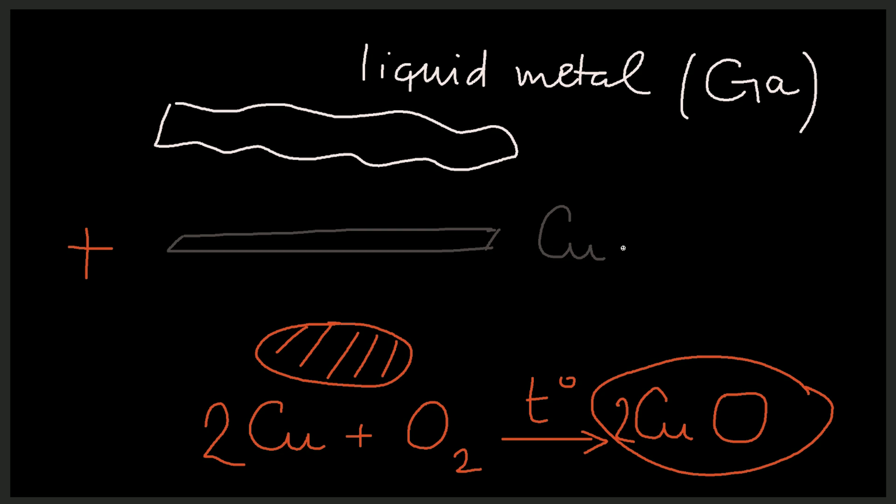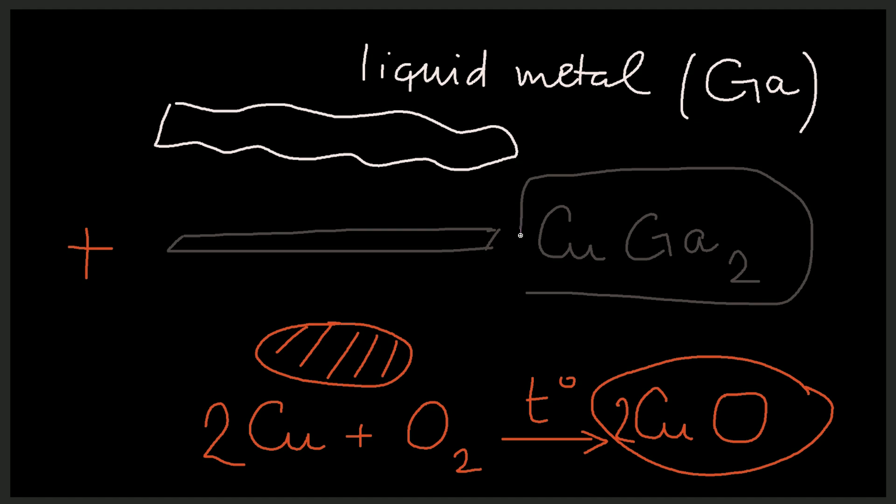The chemical reaction creates a layer of copper-gallium that seems to stay permanently. Although this layer is non-liquid, it does help prevent liquid metal from continuing to react with copper, and vice versa. So having this layer isn't bad. That's why I said putting more TIM can be good, because we still have extra liquid metal after the reaction completes. This is just my two cents, so don't take my word for it — reality is often disappointing.